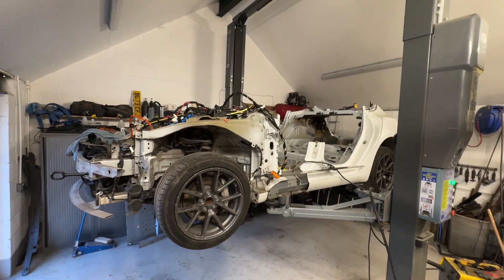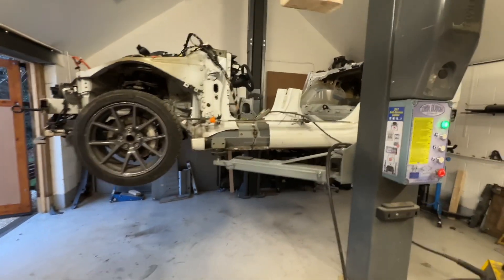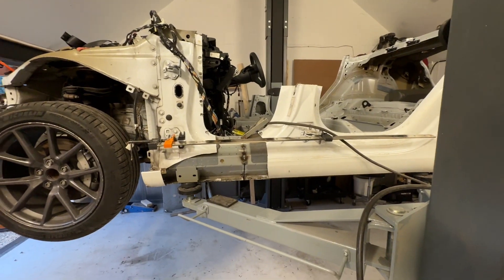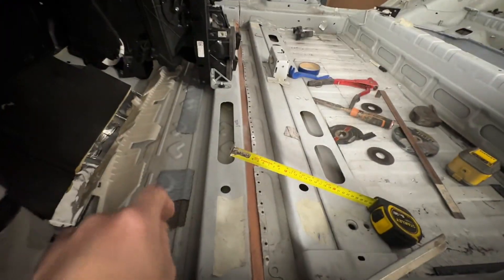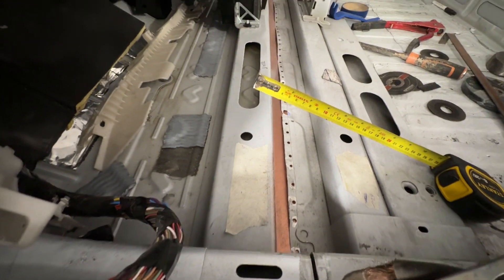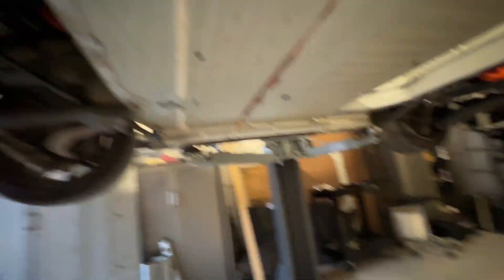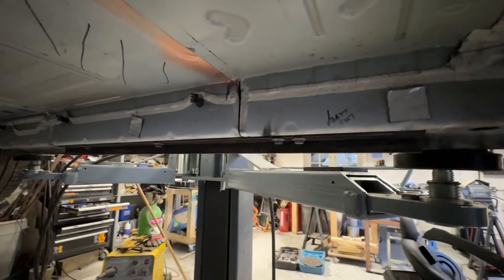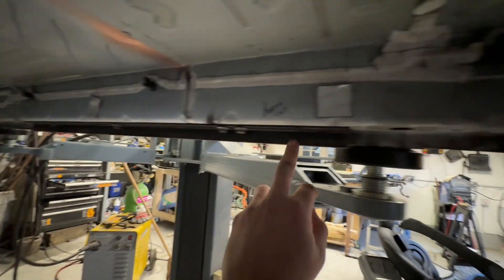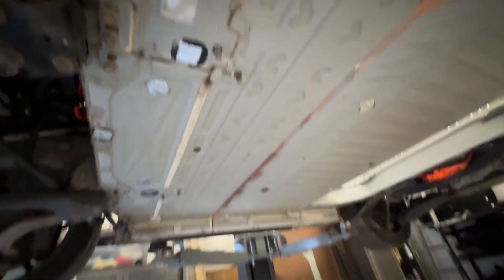We have a tacked together short wheelbase Tesla. I was using a sash cramp between the original door hinges just to tweak the gap to my reference dimensions — I put a mark there and closed it up. That floor pan seam is going to be nice. I had some minor issues just getting it lined up perfectly, so in the end I got this steel angle section and bolted that up and that kept it true. Still final welding to do — but yeah, feels like it's coming together.